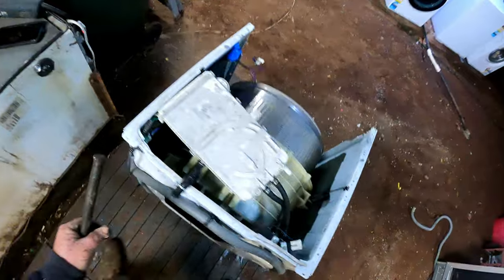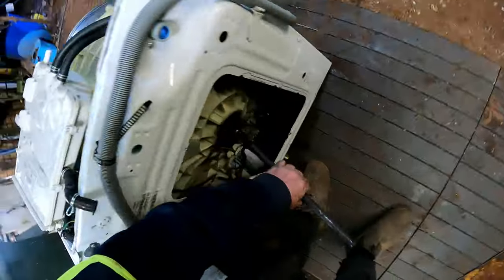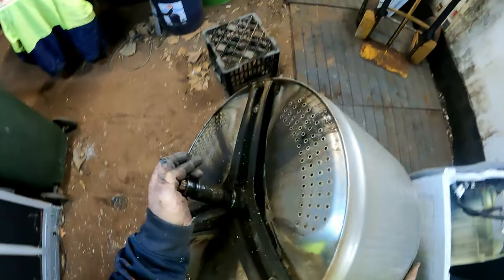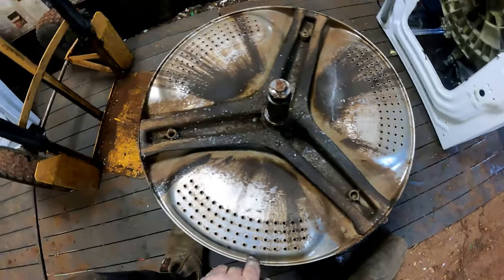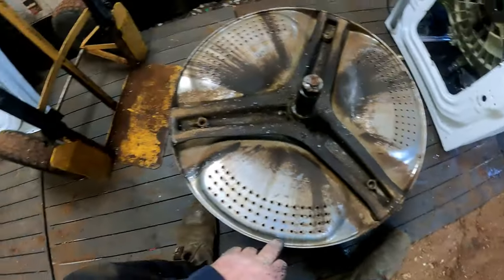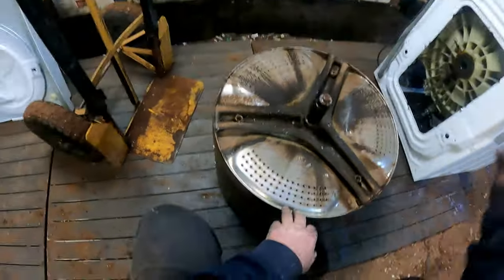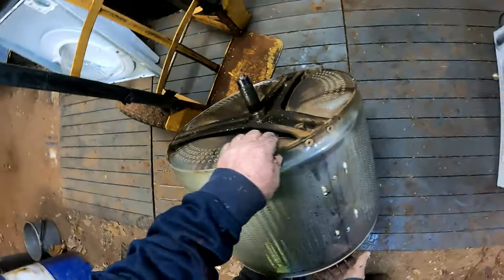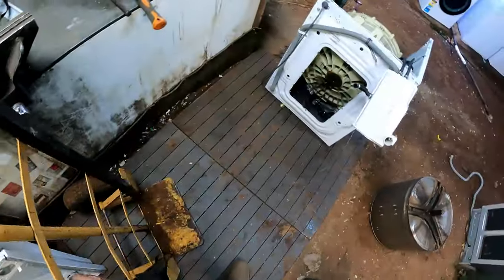Hurray - it's moving, it's moving a lot! It's out - what do we get - the bearing the whole lot? No, terrific. It is definitely not the spider gear - this is your spider gear. I'll have to get all the dirt out of that. But it looks like it's the seal and some bearings. She's repairable, so we'll continue on. I'll pull it apart - but that needs a good clean. I'll give it the gurney old treatment, give it a good wash up.